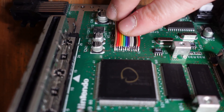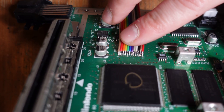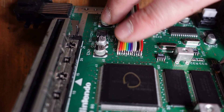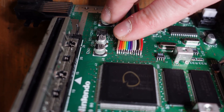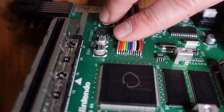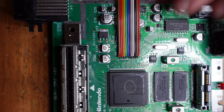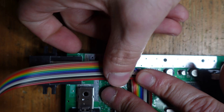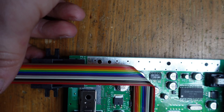I've gone ahead and finished that, and I just wanted to tilt the console to an angle so you can see where each wire goes and that there aren't any bridges. After you do this, if it's your first time, I definitely recommend getting a multimeter, putting it into continuity mode, and testing point by point each of these pins to make sure they're not bridged together. A magnifying lens or microscope also helps — you can zoom in and take a close look. Once that's all set, the worst of it is really over. The next thing is to take this cable assembly, fold it right along the edge where the capacitor is — just a small crease — and it's going to go up along the multi-out.